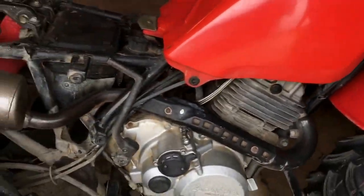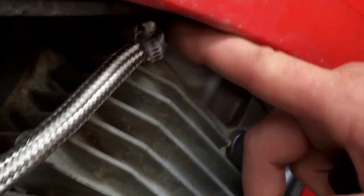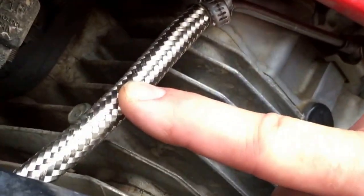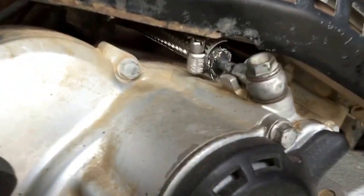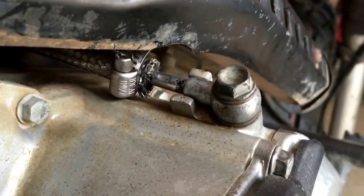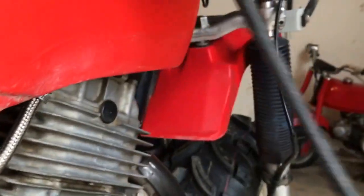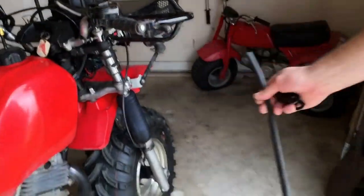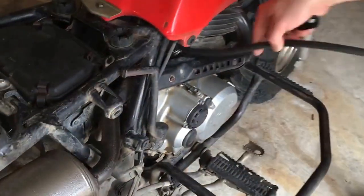If you come to the other side of the bike, you'll see that the factory steel oil line was cut using a tubing cutter. I left about an inch or two on each end — that steel line comes down inside the hose about this far. The more length you leave, the more options you have down the road if any of this frays or tears or gets cut. To route the line where I wanted it, I used a piece of fuel line about three feet long — it was very flexible.